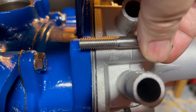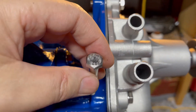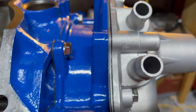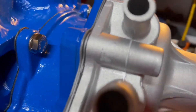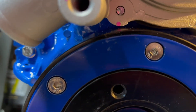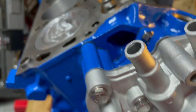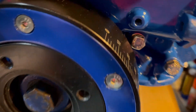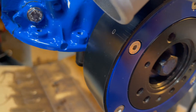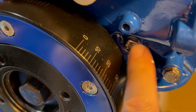With the washer on there, I'm just going to buy a quarter-inch bolt. I like these polished bolts, but maybe if I buy a stainless bolt I can polish it myself and nobody will notice the difference. So that's where I am right now. I'm going to take this water pump back off and try to get some clearance in there because it's almost touching. Then I'll put my timing pointer on — it's about top dead center right now, but I'm going to check it with a micrometer. This timing cover comes with multiple timing marks, and this is what I'm going to use for my pointer.